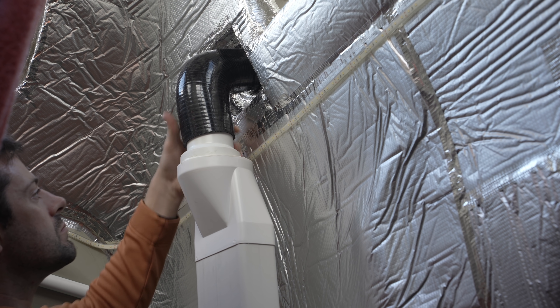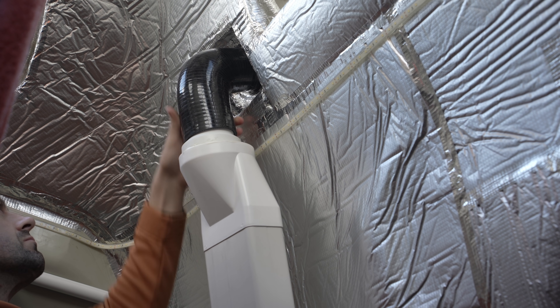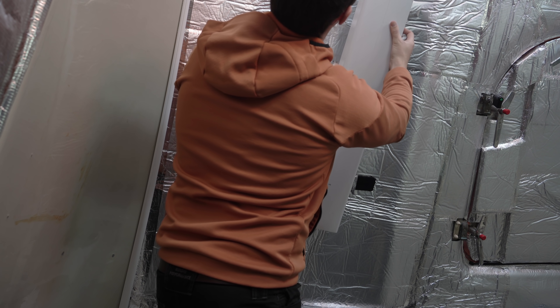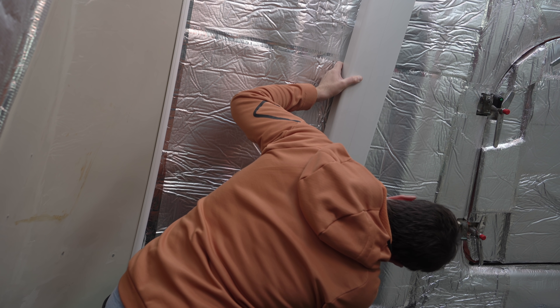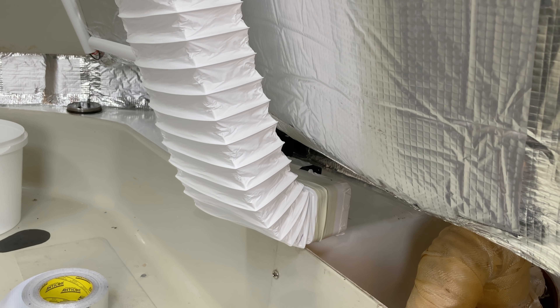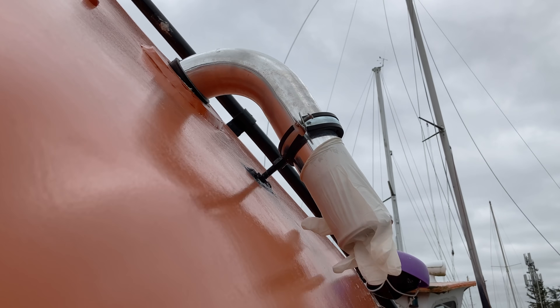I was pleased I could get the black right angle in a snug fit, and not made from rigid plastic — otherwise I might have had to make a custom seal and perhaps a mounting bracket too. All that was then needed was marking where the velcro on the wall was, so I could bond a strip onto the ducting itself. I find PVC plastic accepts good quality adhesives quite well, which is a welcome break from the slipperier, low surface energy nylons and polyethylenes I often have to work with for cold weather applications. This will be the air's route from interior to exterior. The flat ducting is to make sure it doesn't encroach on cabin space, and then there's a smooth exit route to minimise disruption of the airflow.